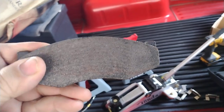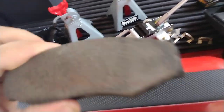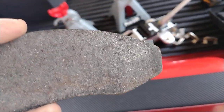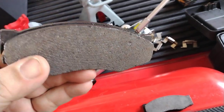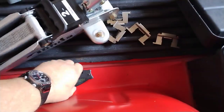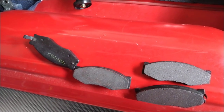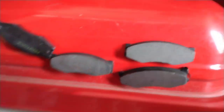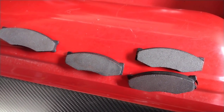These brake pads are center-solid - they're not stress-relieved in the middle. Usually there's a slot in the middle that helps dissipate brake dust. These are solid centered brake pads with little metal flakes in there that help with heat dissipation, give you better grabbing on the rotors, and deal with heat a lot better with low dust. Regular cheap brakes are asbestos or some similar material. When you go buy brakes there's like three types: the real cheap ones, the intermediate ones, and then the high-bite. I like the high-bite because it requires less pedal effort and when you really need to get on the binders they do a great job of stopping.